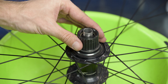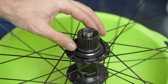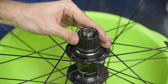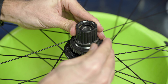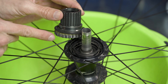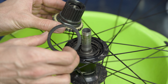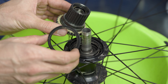Now we are ready to pull the freehub body from the hub. While doing so we'll automatically pull the sealing gasket, which afterwards we'll need to carefully pull back in. I'm pulling it upwards and here it goes. Now we have removed it. This black thing is the sealing gasket. There's some dust over it so it'll need some cleaning, but we'll get to this later.